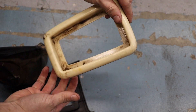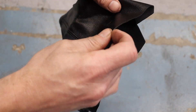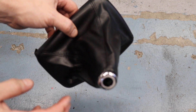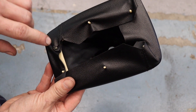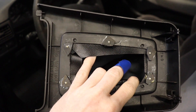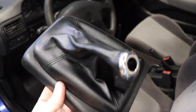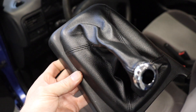There we have it kind of stretched over — that's the plastic piece there. Here's our new shift boot looking pretty good. It does not have any holes on it, so we'll have to line it up with the old one, punch some new holes, then lay it over that template piece. Here's the new shift boot attached to that plastic template piece — underneath I folded everything over so it's going through these nice little pegs. Now we'll put it through the other section and probably use some adhesive to get it to stick. I actually used some Gorilla Glue and some little pieces of rubber held down on there to provide an anchor, since it was modified before from the previous owner. This should hold together pretty good and it looks pretty nice.